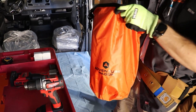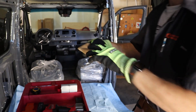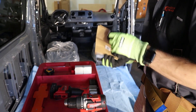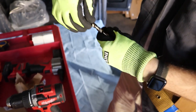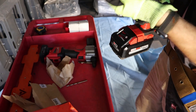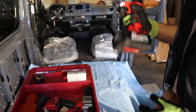After your true centers are marked on all of the ribs, go into your first box in your orange dry bag — your goodie bag. You'll have drill bits: a quarter-inch, a three-sixteenths, and a twenty-five sixty-fourths. For the little cross brackets that go in first, you want your three-sixteenths drill bit, as we'll be using three-sixteenths rivets.